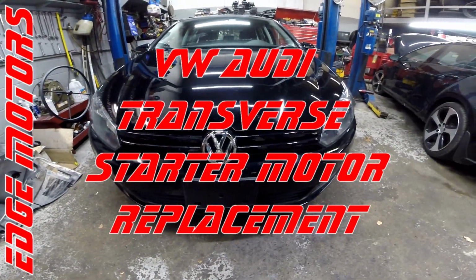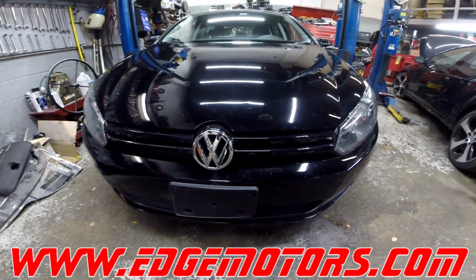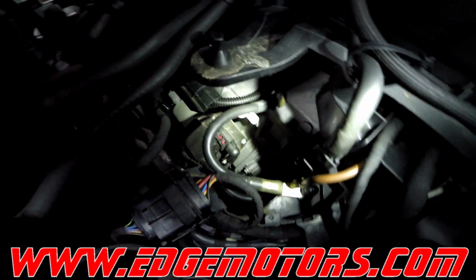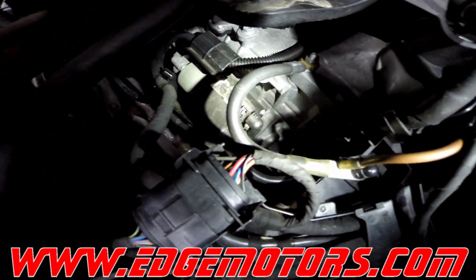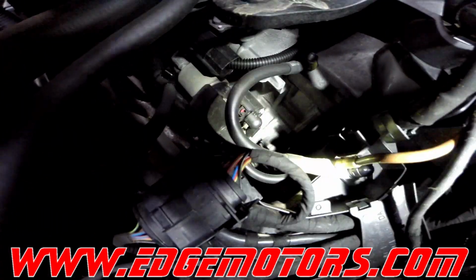Volkswagen Golf 2.5 liter automatic. We're gonna show you how to replace the starter motor. The starter is located right there on the driver's side in the transmission housing. It's only a couple of bolts that hold it down. We're gonna show you how to remove them.